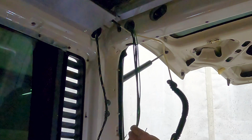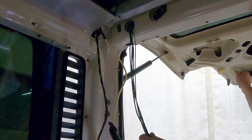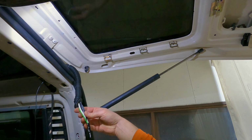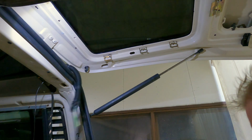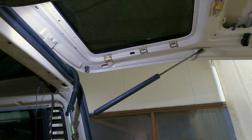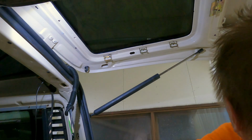So now we have new cables here, and we should solder these cables together. Then I can pull them into the trunk lid. Okay, now we have new flexible cables inside here, and the next thing we need to do is pull these cables through the trunk lid channel, and here I have lots of sockets. You use the same method.